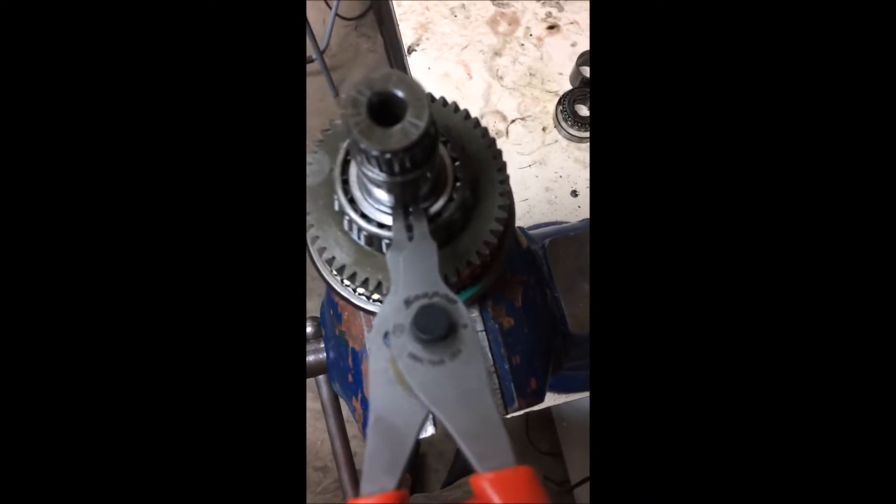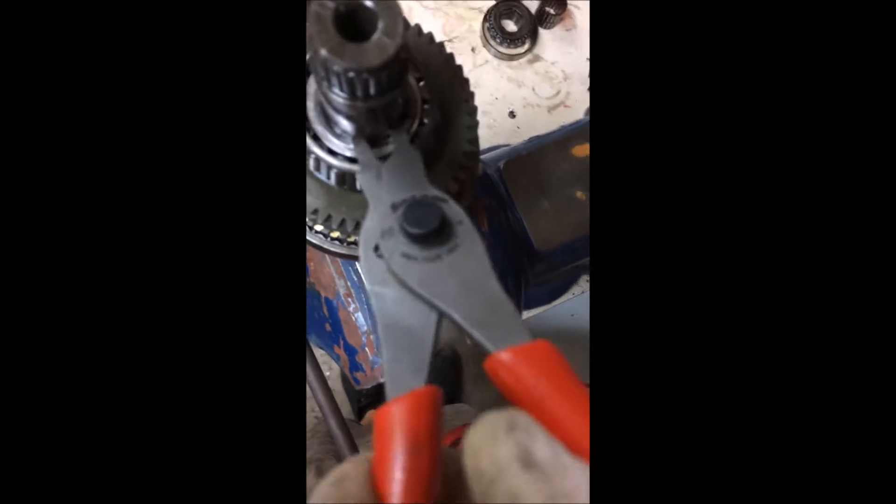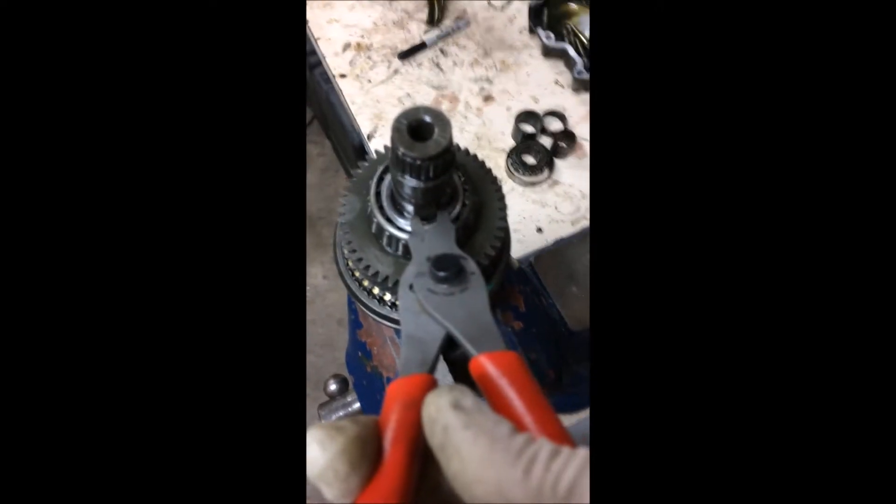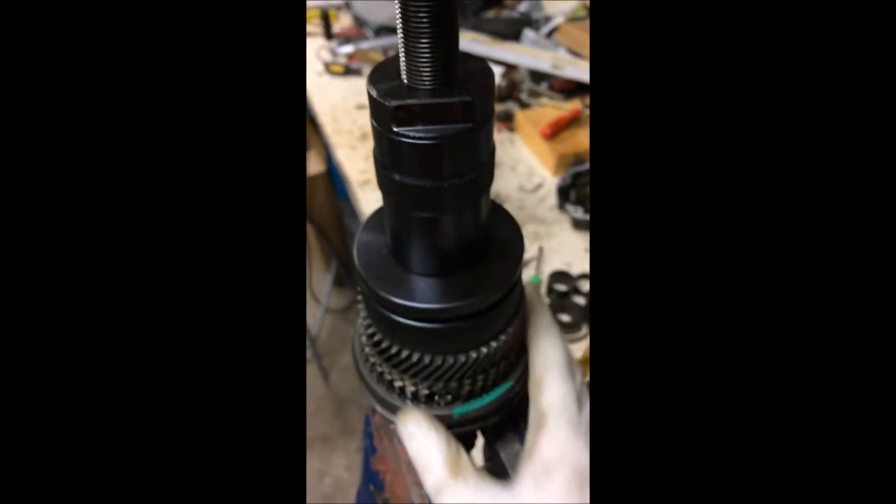Excuse my garage, it's kind of messy right now, but let's see if I can take this apart with one hand and try to film. Let me give you guys some tips on how to do these. First, for the input shaft, you start by taking this snap ring retainer off. I'll have that off and try to take the shaft apart. I got the retainer off - you never want to reuse those, as you can see it's pretty deformed. Always replace them, they're cheap. I've got my special tool on here to remove the bearing. I've used just a bearing puller before, but this came in the kit that I bought.